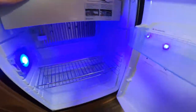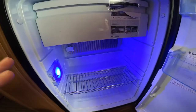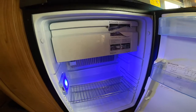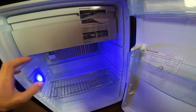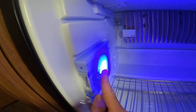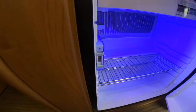When you're finished with the fridge for the season — around November/December — take everything out, clean it out. There's a little toggle on the light: push it in, slide it forward, the pins pop out, rest the door against it, and that allows air circulation down the side of the rubber to stop mould and bacteria growing in your fridge. It's always recommended to leave it open.